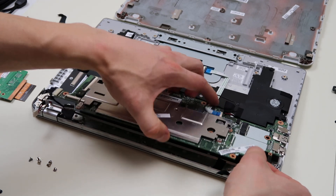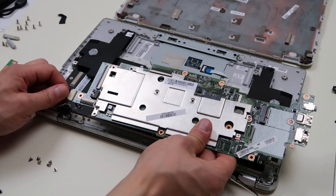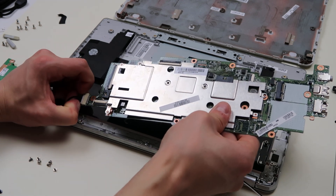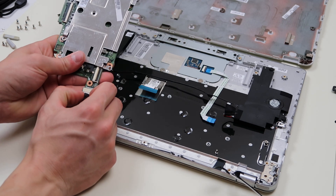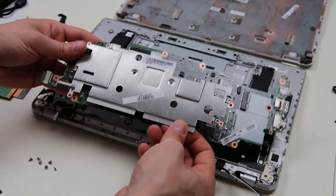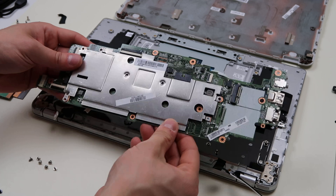We're still stuck on something here. I missed the little plug-in right there, so unplug that — by the port, not by the wire. And there's your motherboard. The heat sink just came off because I unscrewed it, but that's how you would get your motherboard out.